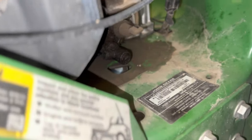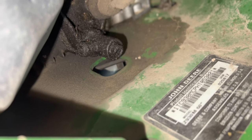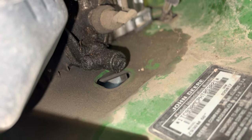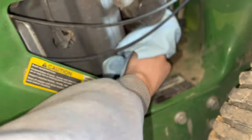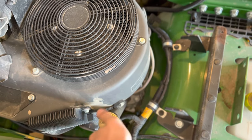I turned my flashlight on. We need to get down in here — there should be a little 10mm bolt that I need to loosen and that should let all the oil out. I'm going to get my pan put under there. Before I get in here and do this, I want to clean the area. I'm also going to loosen the dipstick so we got a little bit of air flowing in there, and then let's go get a wrench and a ratchet.